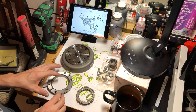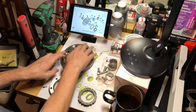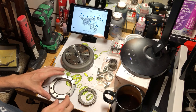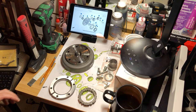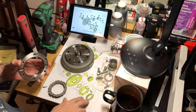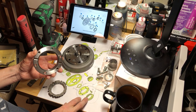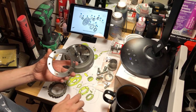Depending on whether you need a new starter clutch like I did, you're going to have to disassemble yours. We bought brand new bolts — basically six allen bolts that hold this on, and I've already removed them. For reassembly, you can see in the diagram the direction it fits. These diagrams are available at motosport.com — look up your year, search for OEM parts, and there's a diagram for pretty much anything you need.